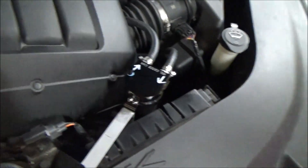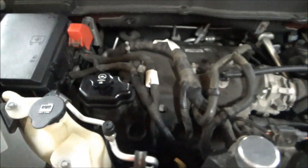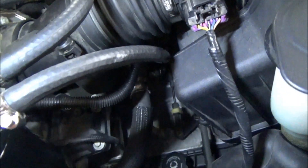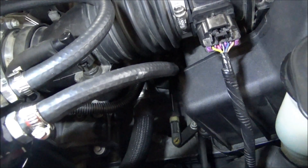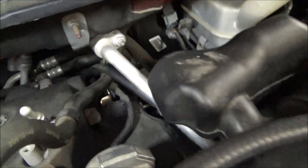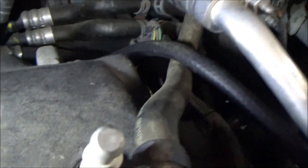If you want to install one on your side, remove the engine cover. For the foul air side, marked by the 'in' mark, I used 3/8 inch heater hose from O'Reilly Auto Parts, routed down between this intake duct, along and under, then back up on that vacuum hose, and then all the way back going directly onto the stock PCV valve and fitting.